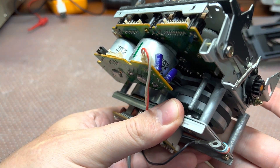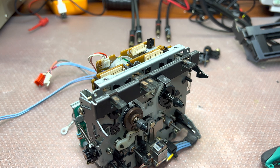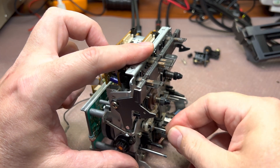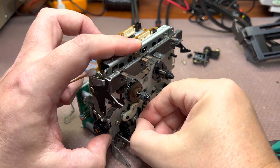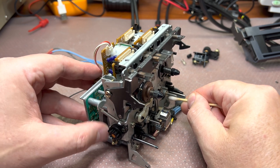We're done with this part — now both capstans are rolling free. Next part: we have to clean up oil from the top part of the capstans. I will use a cotton swab with isopropyl to clean it up, but before that I'll place the spacers — the larger one goes to the right side and the smaller one to the left side. Now I will clean with isopropyl while rotating the capstans, because we don't want our new pinch rollers to be exposed to any oil.